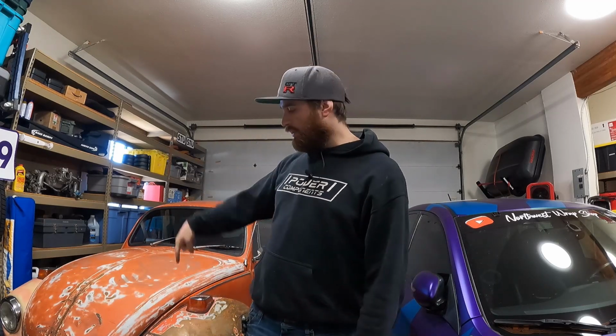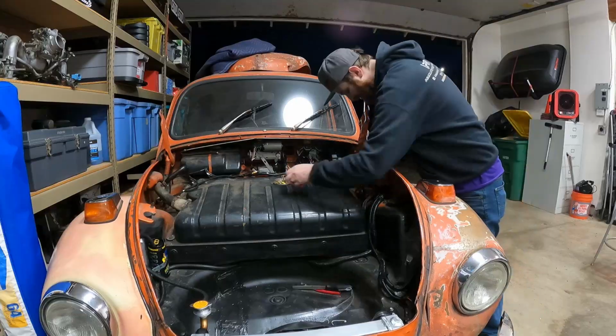All right, so obviously up next, we need to get the cooling system wrapped up by getting a radiator fan to work. Now, I've found that it looks like the issue with it not turning on with temperature is due to the ECU or the relay back there. I don't have any of that stuff to quickly fix it. So instead, what we are going to do is install a new radiator fan relay and a switch to power it on. It could someday be changed from a switch to a thermo switch that would go into the cooling system, probably right by the radiator, that would kick that fan on when it's needed. But for now, it's on a toggle switch. So let's go ahead, let's get that relay installed, get that and our start stop button switch bracket made and mounted. And I'll show you guys when we get it all done.